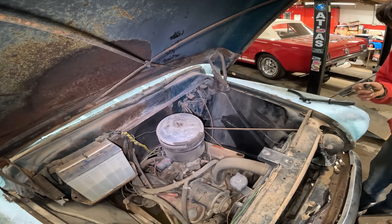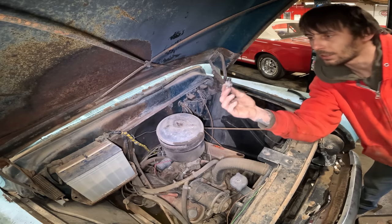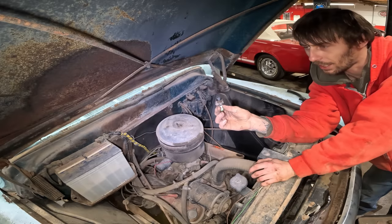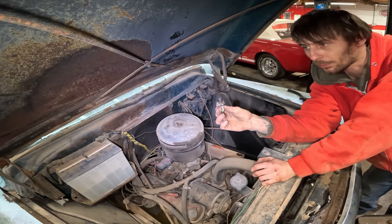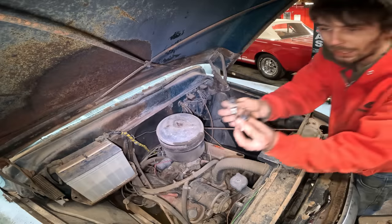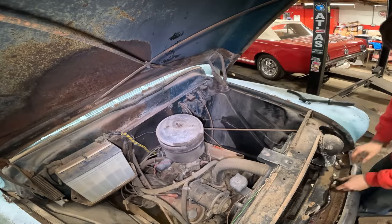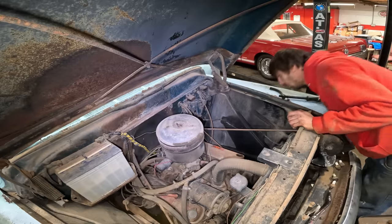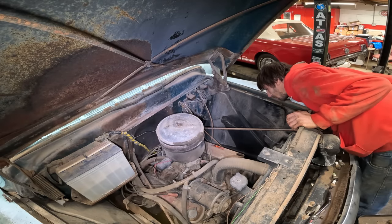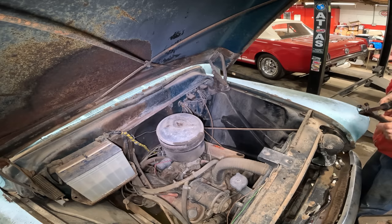This one's blown up, I think. See all that? See how that pushed the whole inside of the plug down in? That's a sign of a wrist pin or a connecting rod letting loose and the piston hitting the spark plug. You can see the comparison. We could get back down bottom and see if the flywheel will turn without spark plugs, so no compression will be made.